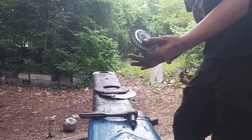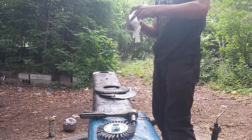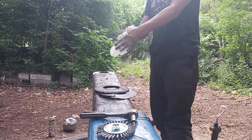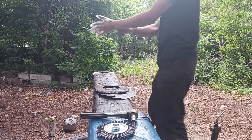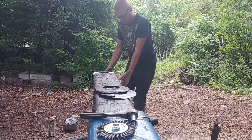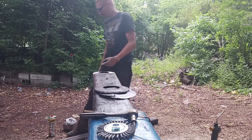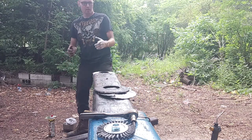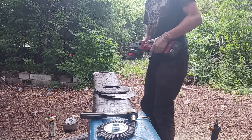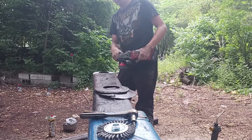I've got a couple of different wire wheels here. There is a bronze bushing in here also, and that is going to be a little bit worn out — there will be some slop in there. So even if I replace the pivot plates, it's not going to be perfect. I've towed some really heavy stuff and I'm sure this thing's been used and abused. One of the arms on this clamp is a little bit bent out so I'll put it in the press and get it together. I'm going to clean as much as I can off this area and then put fresh grease in there — there's a lot of old built-up caked stuff full of dirt.